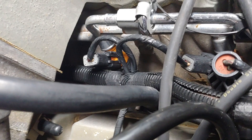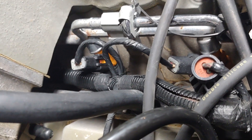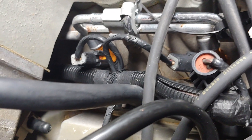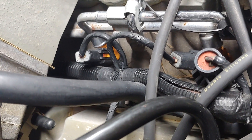When you want to test injectors, there's going to be 12 volt power all the time with the key on, and then the other wire is going to be a ground. That ground runs to the computer. When the computer wants to turn the injector on, the power is already going to be there, and the computer is going to supply the ground for about 2 or 3 thousandths of a second at a time — that's called pulse width.